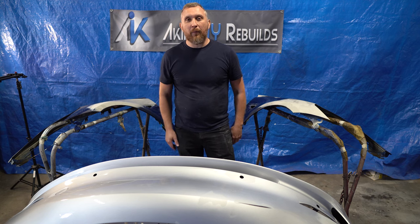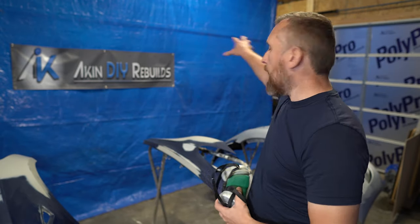We're all done with the prep — let's get to the next stage, which is painting. There are several things to consider. First is your airflow. What I'd suggest is raise your garage door a little bit and set a couple of fans — like a Walmart $10 type of fan — right underneath the garage door to control overspray to some degree. What I've set up is a tarp wall on each side, basically creating a tunnel with my gable fan and an open door to control overspray. Another thing to consider is protective gear — you can get a cheap $5 or $10 painter's suit.